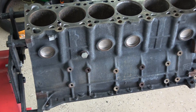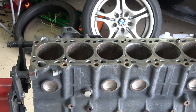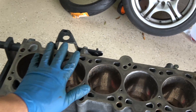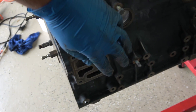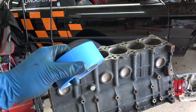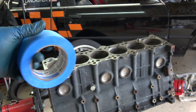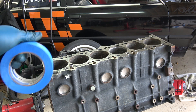This is what you want the surface of the block to look like before applying paint. The next step is to mask off any part that I don't want painted — that will be the top, the front, and the oil filter housing inlet. I like using blue painter's tape since it has less adhesive than regular masking tape. It's a lot nicer when you remove it and it doesn't leave glue behind, which you'd have to clean up and could potentially damage the paint.